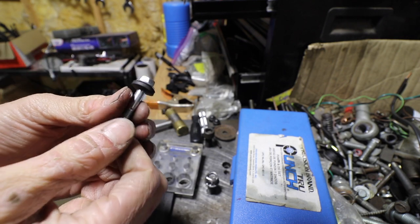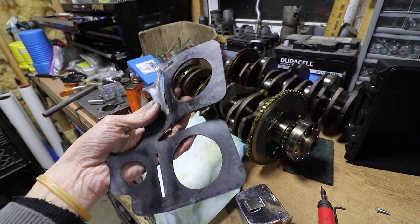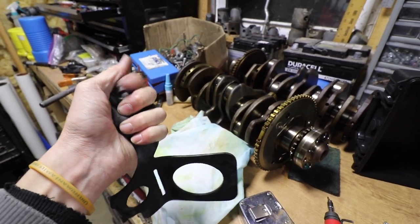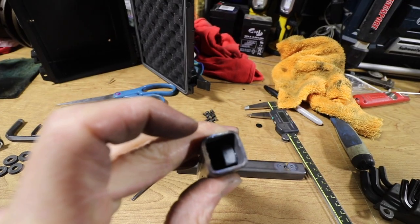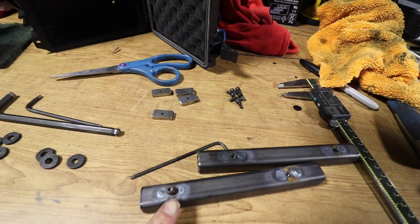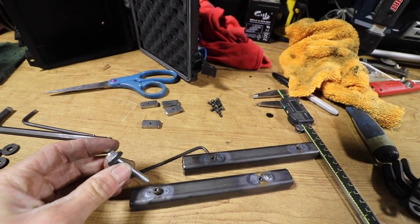This washer is perfect for the M6 bolt — it'll pass right through that hole in the bottom and seal perfectly. I've got eight of them cut from this little piece of rubber, which actually came from a jet ski from the mid-90s. This rubber has been exposed to oil, gas, heat, and cold temperatures in winter and it's still super pliable — maybe silicone or some similar rubber — so it'll definitely hold up. Now these threaded pieces that I welded in: when I tap them M6, the thread will have meat to grab onto instead of just the super thin wall. The screws held this little nut insert tight and they're welded in place — super solid, not going anywhere. These now need to be drilled out to M6 and tapped.